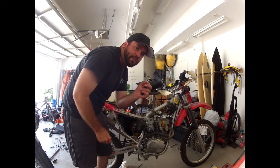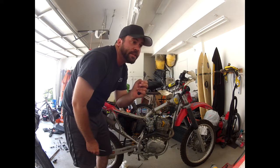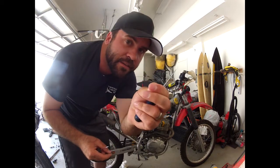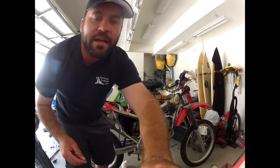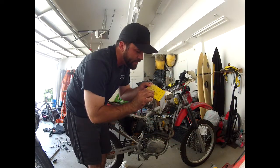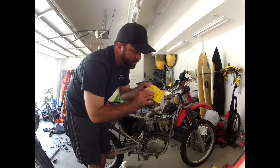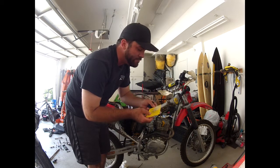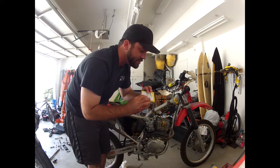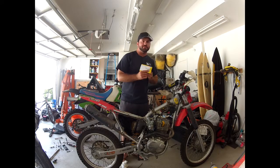When you pull your old screw out, know that there's a little o-ring and typically a washer in there — it's very tiny. I bought my screw from CRF's Only, and they provide a kit with a new o-ring, washer, and spring for like an additional eight bucks. If you don't go for that kit, make sure you salvage those things and make sure they're in good condition. At this point it's good practice to do a quick trial fit on the new screw — no spring, no washer, no o-ring.